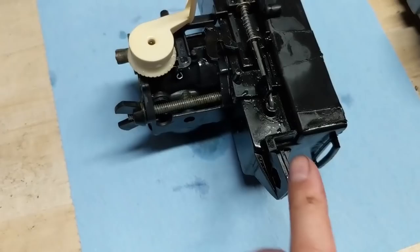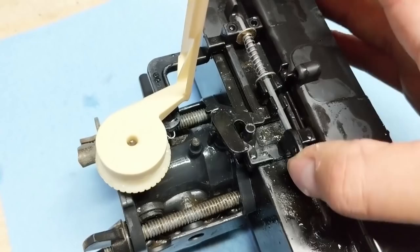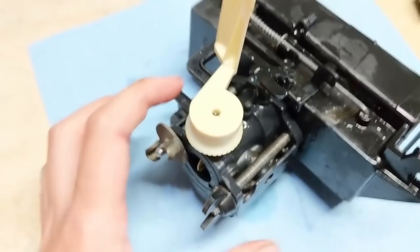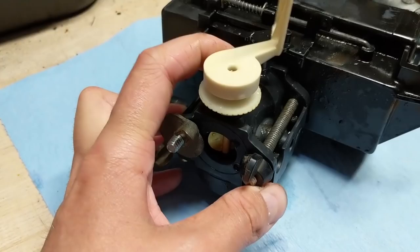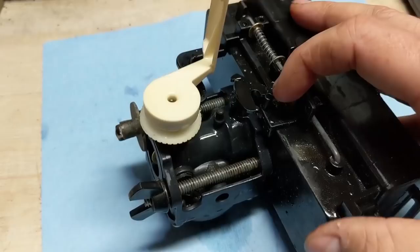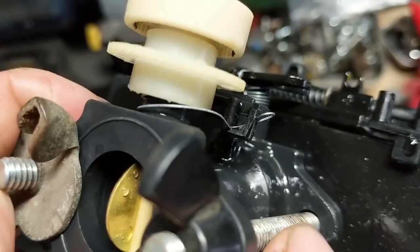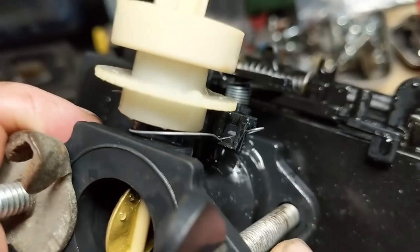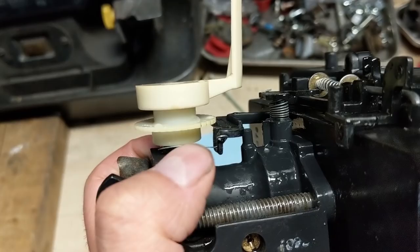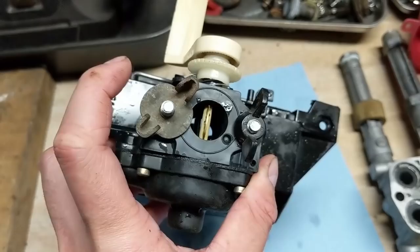This is how the system works: your throttle cable hooks up to this lever. When you put your throttle on choke, this little bar comes over and pushes that lever to put your engine on choke. When running, the butterfly valve is under full tension — you can see it snaps back right away. When you shut the machine off, it pushes on that spring and takes tension off so it doesn't close as fast. The reason I haven't separated the air box from the carburetor is that these little wires can get brittle, and when you bend them out to remove the carburetor they can break. So I just run two wing nuts and everything stays together.